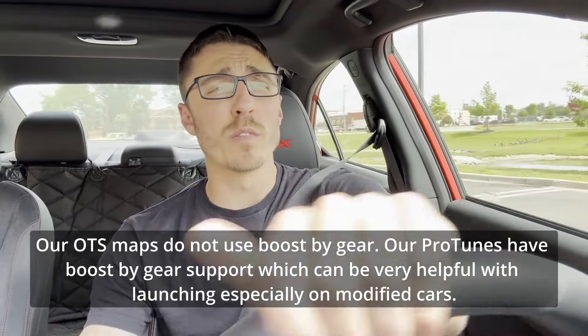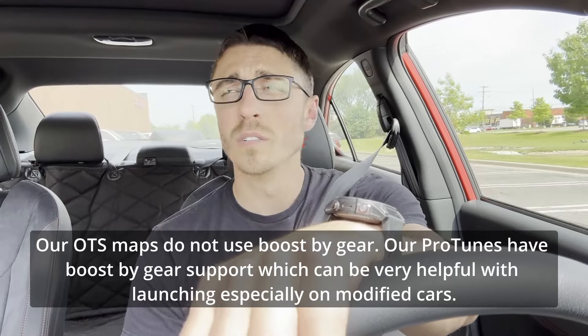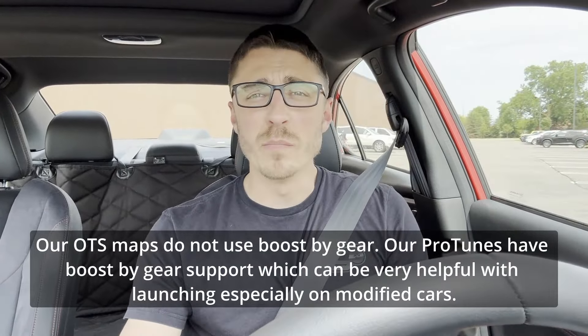Let's do a little demonstration. First gear traction can heavily depend on how your tune is set up and how much power you're making. If you're planning on launching the car, let's talk about that so I can make sure it's optimized for you. Right now I've got launch control set to 3,800 RPM. Starting lower is much better than starting higher — I'd rather you bog the car a little bit than spin really bad or smoke your clutch. Maybe even 3,300 RPM is a good starting point.